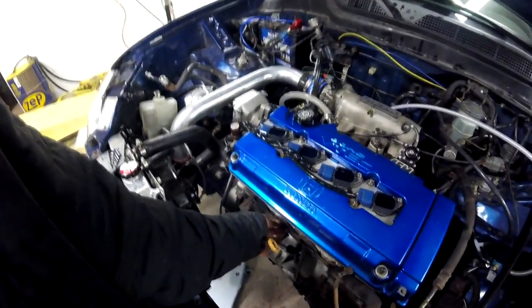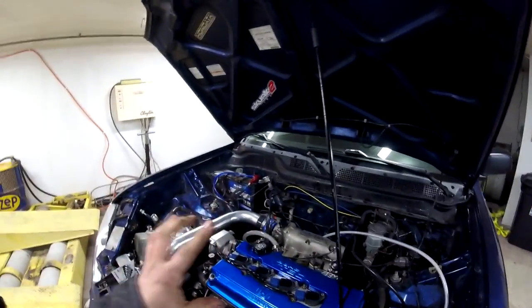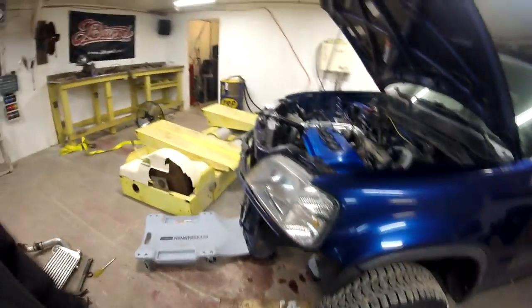I have to get some manifold bolts — I pulled out all the studs besides the corner ones. I usually like to keep the corner studs in the head and then run bolts on all the other ones, because the nuts on studs sometimes tend to back out. A flanged head bolt works a lot better for a turbo car because the turbo causes more vibration. I also got rid of the washer tank and trimmed the inner fender liner down so we can run the piping more normally. Now I'm going to throw everything back together slowly, put the sandwich plate back on, get everything sealed, and run the feed line back up.